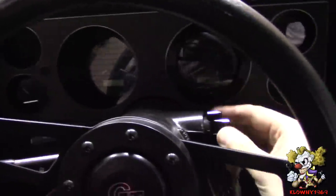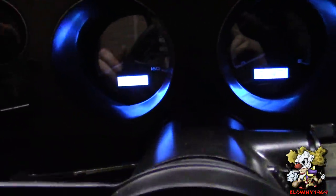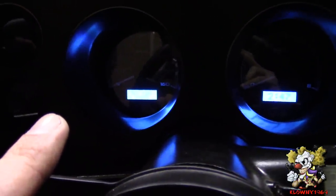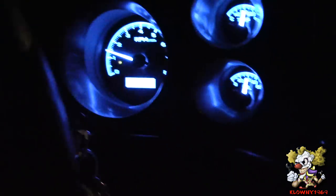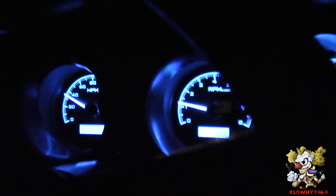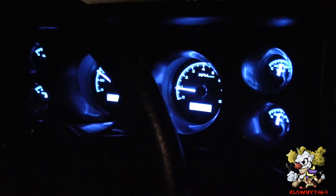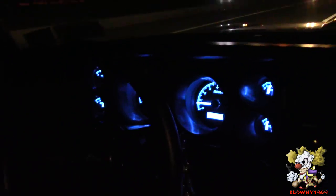Everything's done. Now we just have to turn it on and set everything. We have to calibrate everything — you set the fuel sender and speed calibration first. We're driving now and there are a bunch of settings you go through using the momentary switches underneath, pressing them back and forth. I recorded the setup process on my previous Dakota Dash videos so I'm not going to repeat it here — that link is in the description below. Another nice dash from Dakota Digital — they make real nice stuff. Thanks for watching, subscribe, like, and share. Also follow me on Instagram, Facebook, and Twitter at clowny1969. See ya!